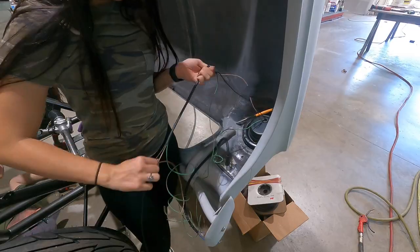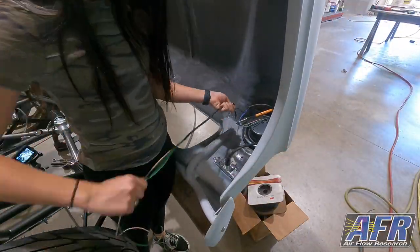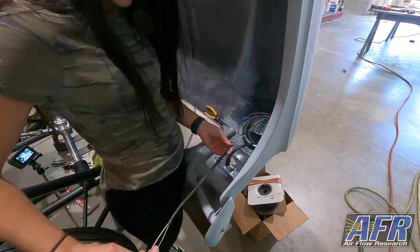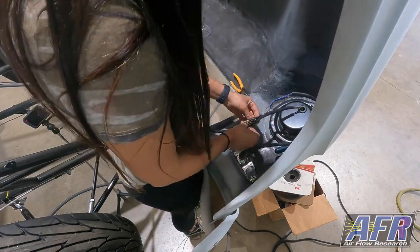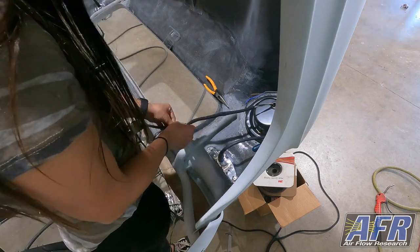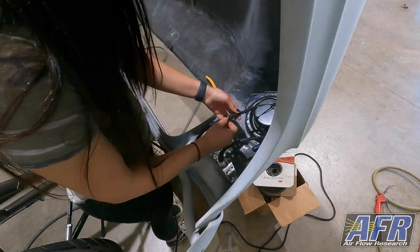Okay, I can probably start on this one because this is the beginning of never-ending wiring. I think it went on for a literal straight 2 weeks. Here we started wiring the front ends. Headlights, all we had starting this chassis wiring was just the pigtail. So we had the headlight pigtails and taillight pigtails and a flasher. And the rest was make it up as you go.